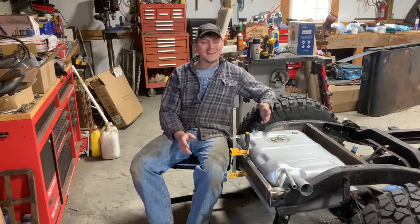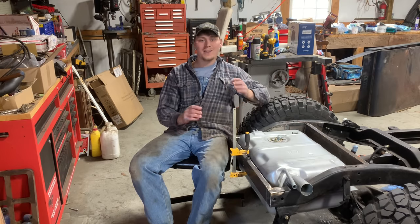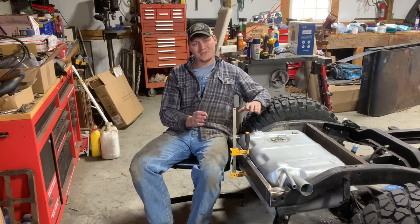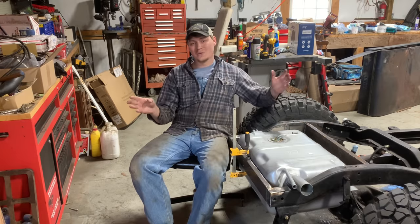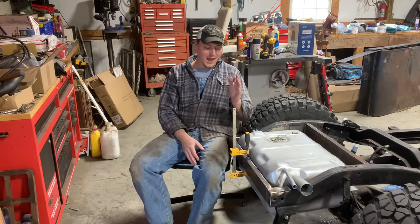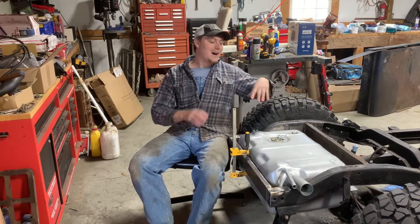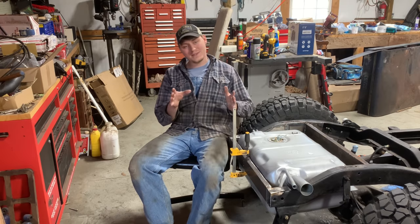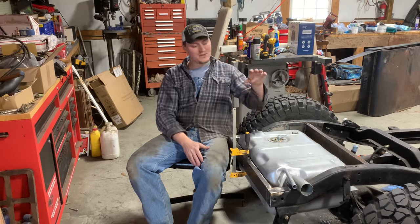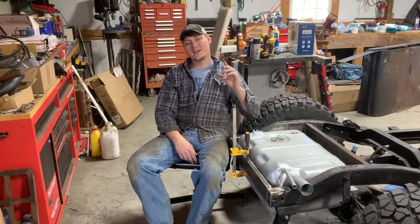I don't think there's any way anybody can say that the rear of this Jeep frame is not structurally sound anymore. I went ahead and plated on back so I could put this rear crossmember in. I thought it made more sense to put the rear crossmember on top of the plate versus sticking it up inside the C-channel and then plating around it. Now I know the material I used for these crossmembers is way overkill. The main reason I used them is because they're free — I already had them. It's also really nice to have a thicker piece of material you can actually drill and tap into. I know my recovery point back here is way stronger now. To set the position of this middle crossmember, I put the tank back in and tapped it around to where it was as close to the tank as I could get, where I could still get the tank out from underneath. I'm in the home stretch now — I've got to make two bands to go underneath and one on top that will secure everything. Then I think I'm going to do something with that skid plate to tie it all together. Let's grab some strap material and get them things cut.